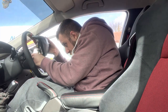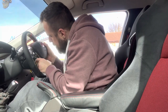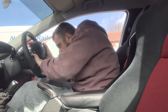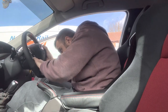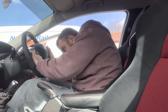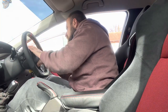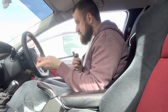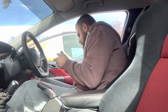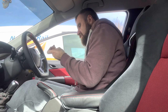We've routed the plug and now aim the plug down into that bracket hole so we're not fishing around for it. There we go. Right, airbag on. Really important afterwards: make sure you test your horn and all your steering wheel functions. And make sure you have the right socket on your wrench — that always helps!